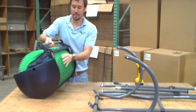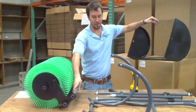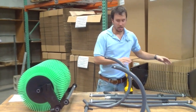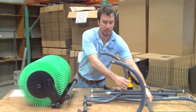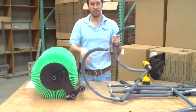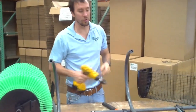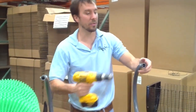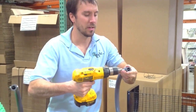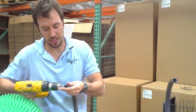Take the head out of the basket and set the basket aside. Start with the basket support bars — they've got two screws on each side at the top. Remove those screws using a number two Phillips head bit. You're also going to need a hammer to assemble this machine.